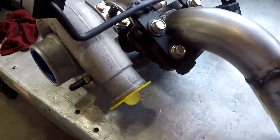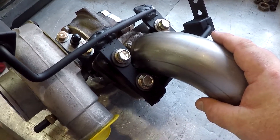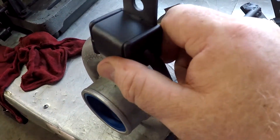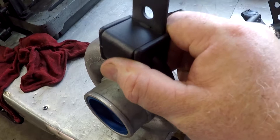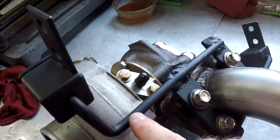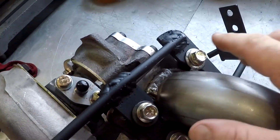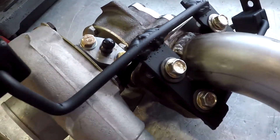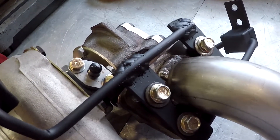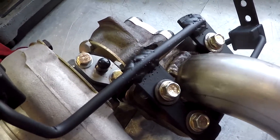On this one I didn't go the way I said I was going to go. I didn't use the flat steel; I went with these little hangers that have rubber bushings inside. These don't give a whole lot, which is kind of what I want where I'm going to put the turbo. A friend of mine at work did the welding for me — thankfully it's going to work and serve the purpose. It's going to hold.